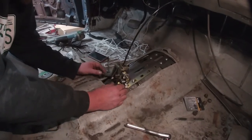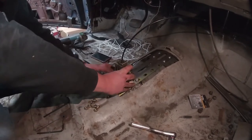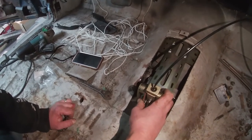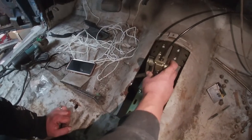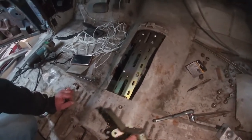So I think really my only option is going to be probably not even there, because that binds up on the floor super hard. You catch that? Look at that. Putting that under there, it's just on the floor. Yeah, you're gonna have to cut your floor out more. I have to cut the floor out more. Even if I went there. Yeah. What car has a turbo 350 that this thing fits in? That's my question. A-body Chevelle.